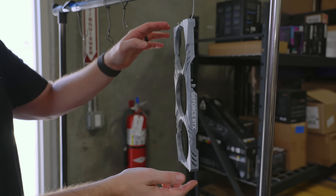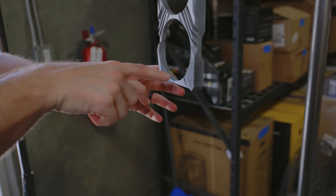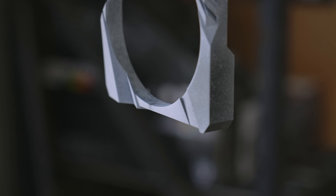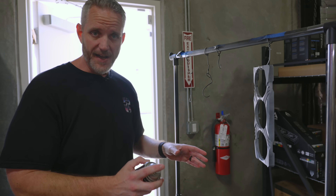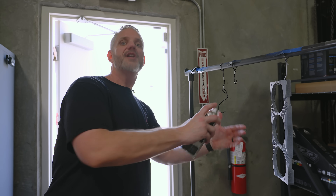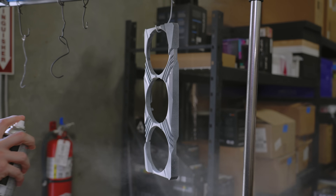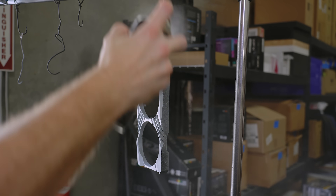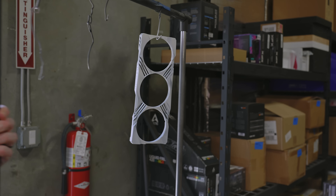This coat is dry. I took my gloves off and I'm flipping it over because you can see a line from where the hook was holding it, so I need to make sure that's covered up. I'm going to go a little heavier this time because now we have some paint that's adhered to it — but I'm still not trying to get full coverage in one or two coats, as that's not going to be possible. I'm going to repeat this process probably five or six times.